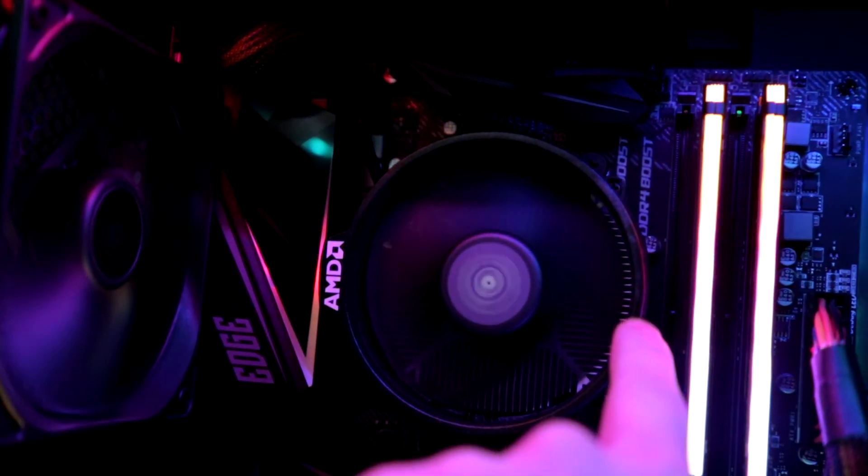The last recommendation is checking your actual CPU fan and the thermal paste you have applied. I remembered that when I was building my PC, I had my AMD stock fan turned one direction, but the AMD logo was sticking out too far and blocking slot one for my memory. So I picked it up and moved it to the other direction. When you do that, you can create air pockets between the heat sink and the CPU, and you may not be spreading the thermal paste evenly. That means heat isn't transferring correctly from the CPU to the heat sink and out through the fan. I recognized that was likely a major issue, and I needed to take the fan off, wipe off the thermal paste, and replace it.